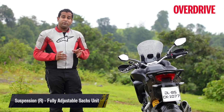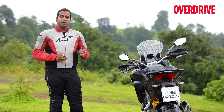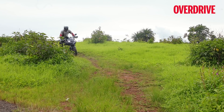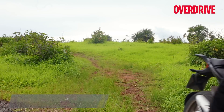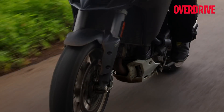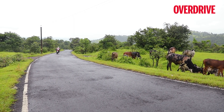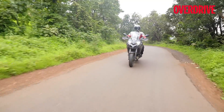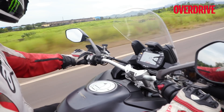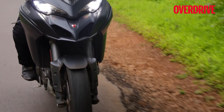In fact, it also gives you more time to think about what's happening and understand how the bike is behaving even when riding it ballistically. A big reason behind that is the recalibrated semi-electronic suspension. Its semi-active suspension is the star of the 1260 S's show — not just when thrashing the bike on tarmac but also when riding it off-road. The recalibration has helped Ducati improve the bike's feel and feedback significantly, and while it is not an off-road focused machine, the 1260 S is always up for a little jaunt off tarmac. On tarmac, it has given up some of the sharpness the 1200 S had when entering corners, as the rake angle is now up by one degree and the swingarm is 56mm longer, but the 1260 S does feel more stable, affording you the confidence to carry higher in-corner speeds.